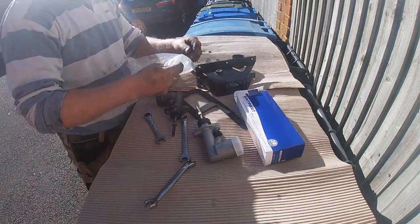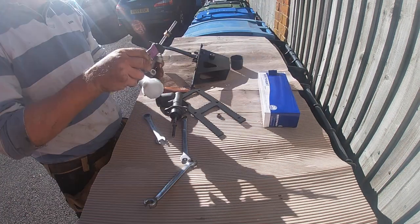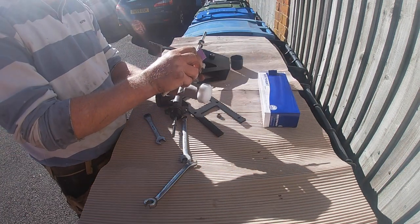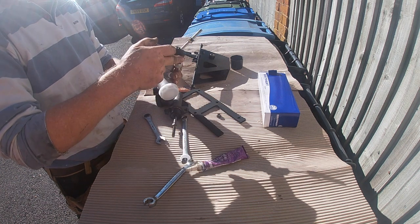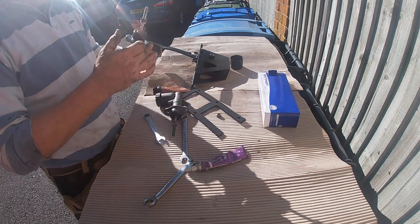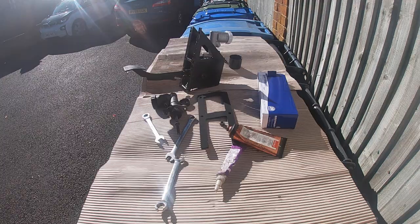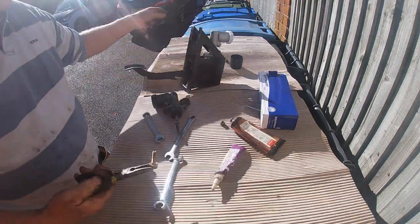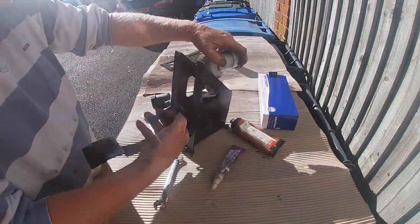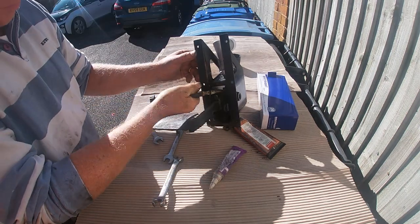I noticed the flange on the old master cylinder had some silicone on it, so I applied some to the flange on the new master cylinder just to be safe. I also applied copper grease to all of the threaded parts. The only way I could locate this bottom bolt was with a pair of pin nose pliers. The space is really limited.